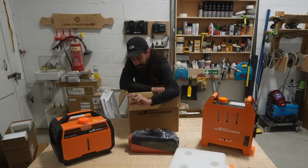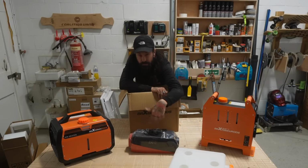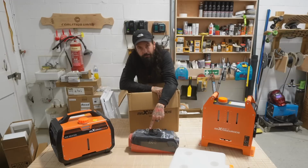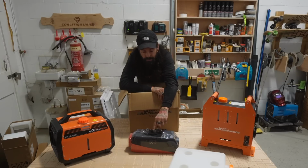So you just put an air filter on there, goes to the outside of your van, it drags in cool air to help the combustion inside the combustion chamber. This one a little bit further away from the diesel in, obviously because you don't want it to get too hot, is the exhaust. Now that does get hot. You don't want to touch that. That gets hundreds and hundreds of degrees, so keep away from that. That's what you connect your exhaust to.